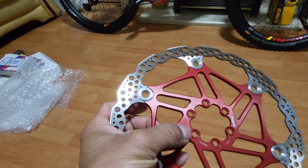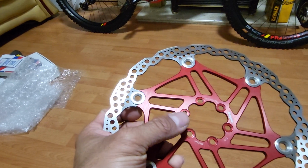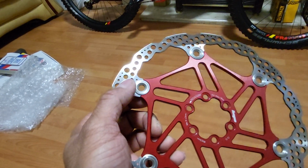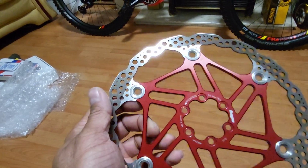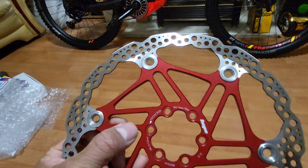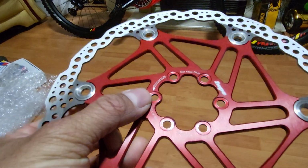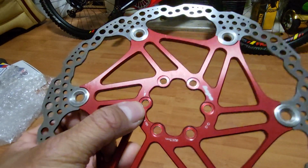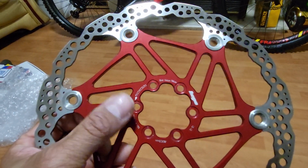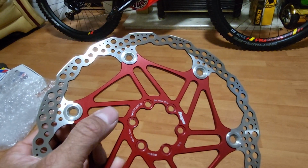So when you install the tyre and put everything back again, it starts sort of catching the speed sensor. So I'm not interested in shimming that speed sensor. Furthermore, you've got to put tiny little washers to rebuild this indent, what you can see here. Otherwise, as soon as you torque the speed disc to 5 Newton meters, it pops out.